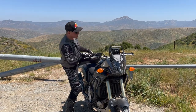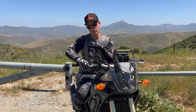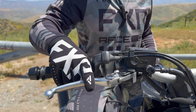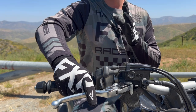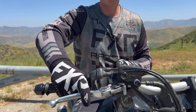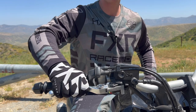A lot of riders engage their front brake using their entire hand — four fingers — which gives them a lot of force on the brake lever. We recommend always riding with just the index finger on the brake lever. It helps with your wrist position, and that's all you need to control the lever and slow the bike down. Off-road, you want to be very gentle — dragging the front brake with a little lever action, not grabbing it.